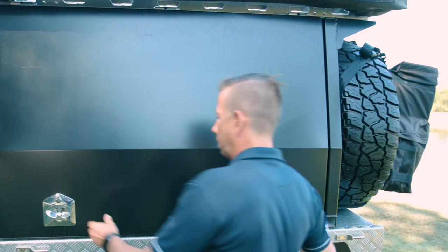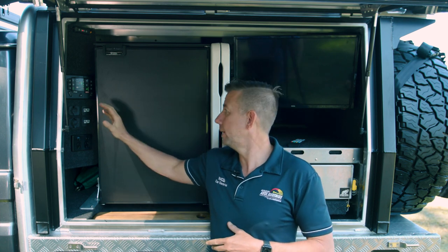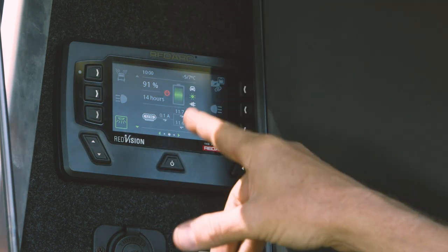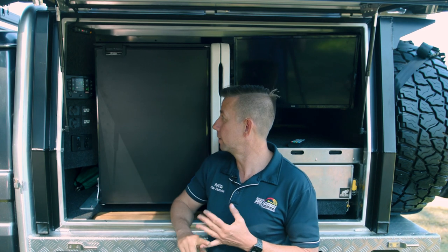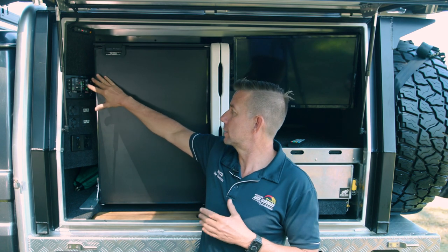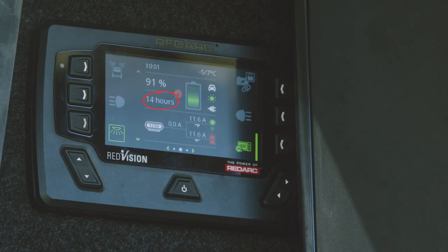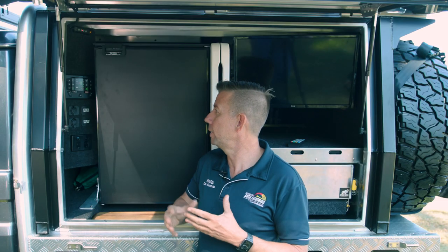So here we are over the other side. The TVMS we were talking about — the other half of what makes it so cool is what's called the RedVision screen. This RedVision screen has got quite a few features. The main one is its battery calculations — looking at it now we can see I'm using 11.6 amps from my battery, because it's running the fridge and also the Travel Buddy at the moment — we've got some pies going on. Not only does it show that, it's calculating the percentage left of the battery. My battery is sitting at 91% and it's working out that at this usage my battery will run for 14 hours before it's discharged. It's literally got an oven running and a fridge, 14 hours with no power input and it'll keep going.